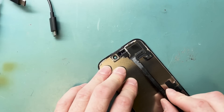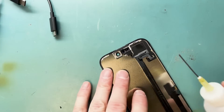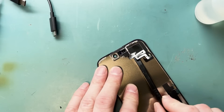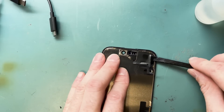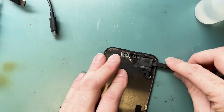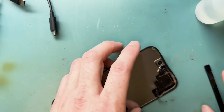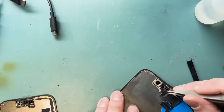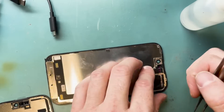On the bright side, if the proximity sensor breaks, Face ID will still work. I tried it without the proximity sensor installed during this repair and Face ID worked, which means if it broke and you had to replace it, it should still work — a lot less stressful. Just wiggle your tool underneath the proximity sensor as carefully as possible. You might need to apply extra heat and use fine-pointed tweezers to work around the edges and pull it out. I wanted to reuse the screen so I took it out as carefully as possible.